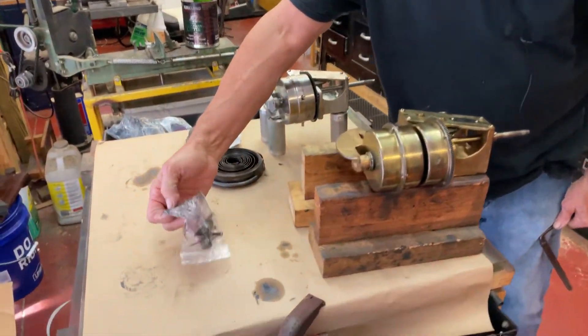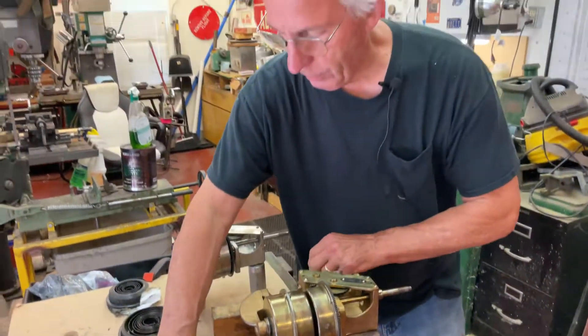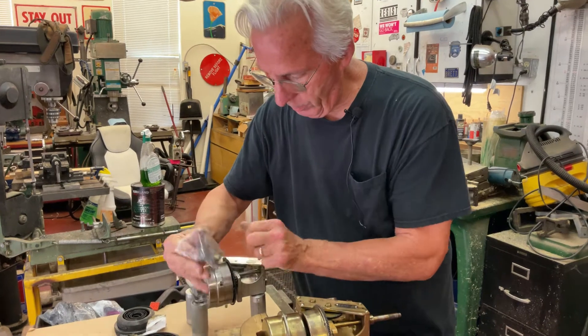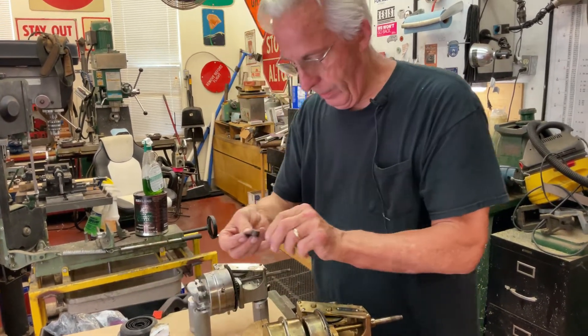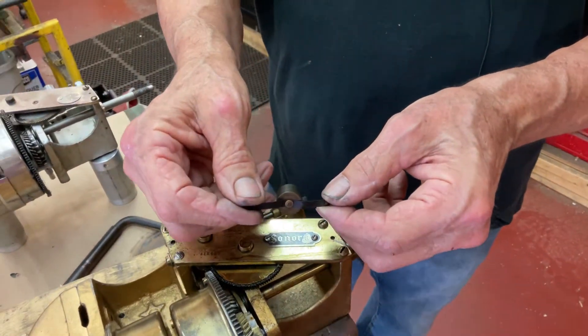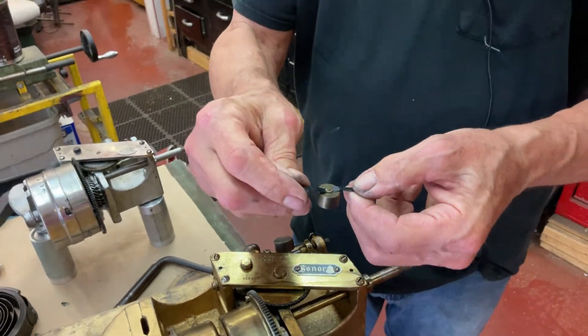On this one I had to do an arbor and redo the governor weights and springs, because in a previous video I showed that these were all bent up. The problem with these weights is that because this gets expensive — these are riveted on. So now you have to find another pair of weights the same size that are riveted in the same spring length. And that's three weights, not just one.